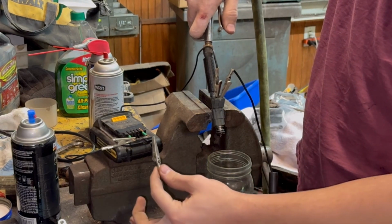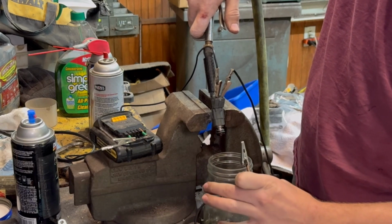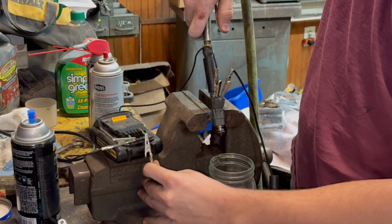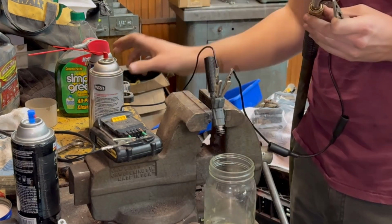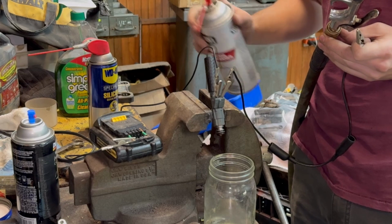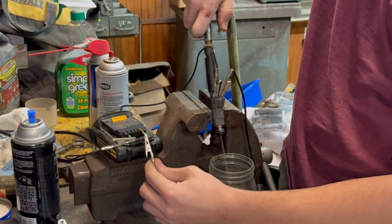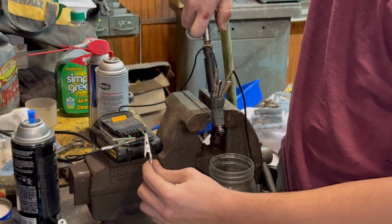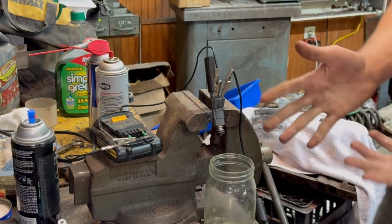So it's pressurized, and then give it some taps. As you can see, and now we're out of cleaner solution. And I mean, you can do more if you want. I'll do a little bit more for the purpose of the demonstration. All right. Should be a clean injector.